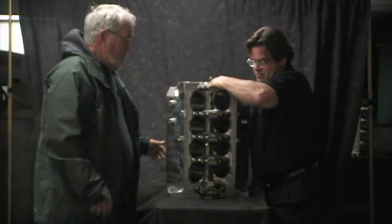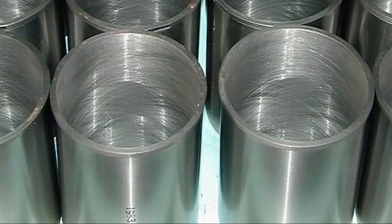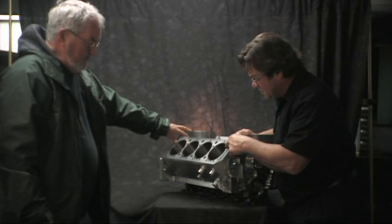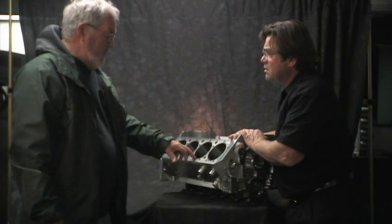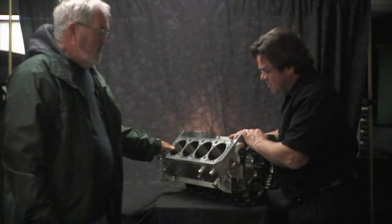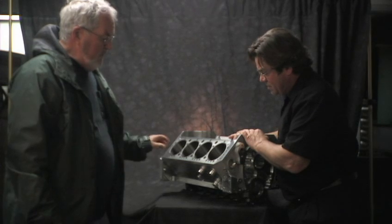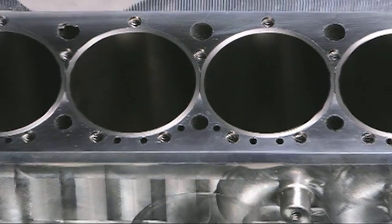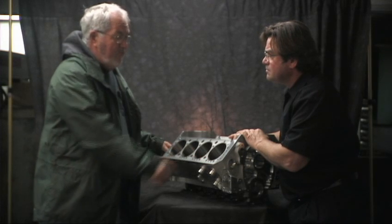What kind of material do we have on the cylinder sleeves here? That's also a ductile iron — centrifugally cast ductile iron. It's a dry sleeve. How much material is there for an overbore? This is 4.120 as the ID of this bore, and about 4.160 is about as big as you really want to go. The OD of this particular sleeve is 4.300, and the flange diameter is about 4.450. Bore centers are 4.400.